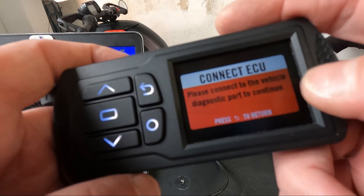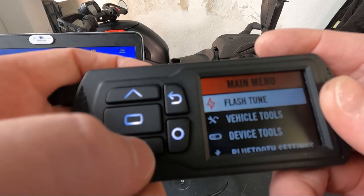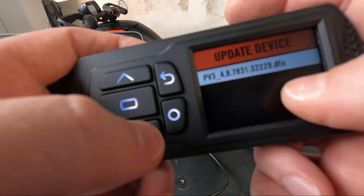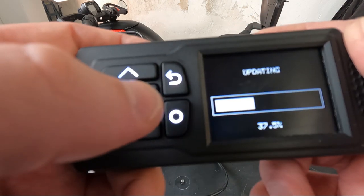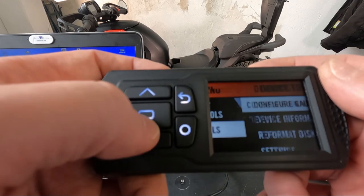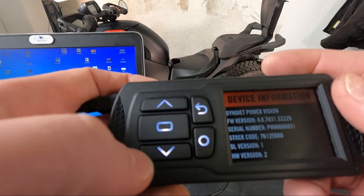Now what you need to do is tell the unit to boot the latest firmware you have recorded to it. So press backspace, then press the menu, go to device tools, go to update device, and this is our file that we have recorded — press OK. Yes, I would like to update it. Just for double checking, I will go to device tools and device information — and 229.4.8 is the file that I downloaded. This is the latest firmware that this tool is running.